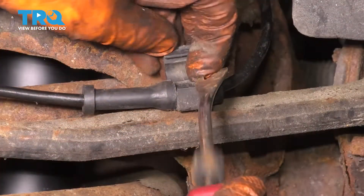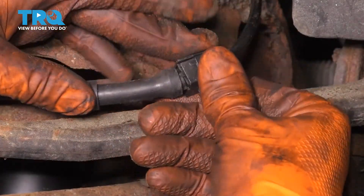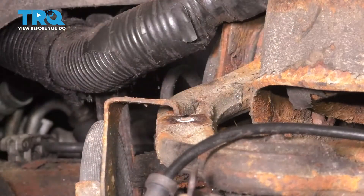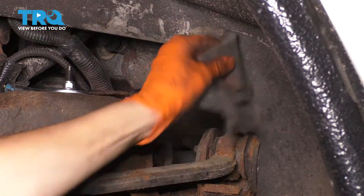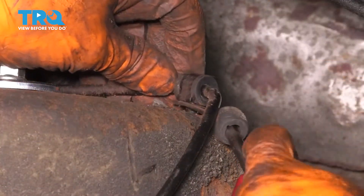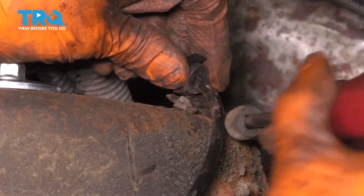Because I have another one I'm just going to go ahead and take this out of here and I'll use my new one on the new control arm. On the right of the control arm there's the 10 millimeter bolt that holds your brake hose in place — remove that. Take this shield off; it's kind of half broken so I'm just going to peel it off these push clips and set it aside. I'm also going to take the ABS wire out of this retainer to get extra slack out of it, so that if it wants to pull more I have the space.